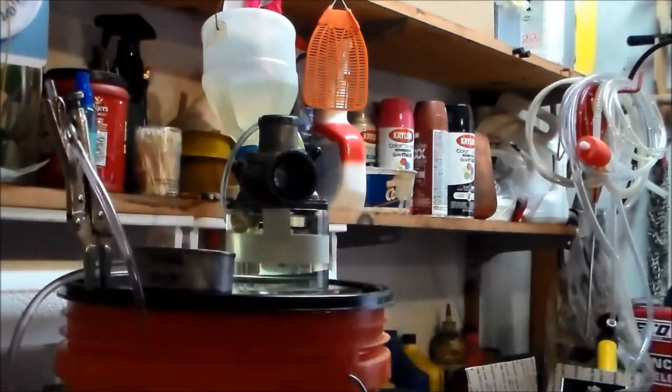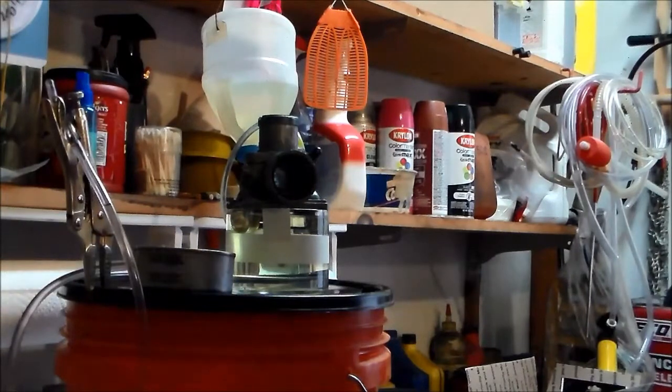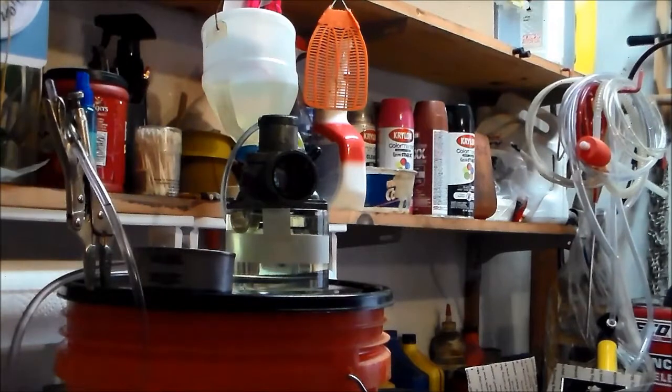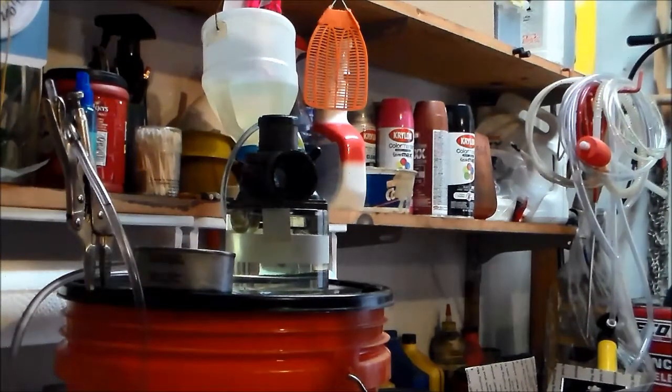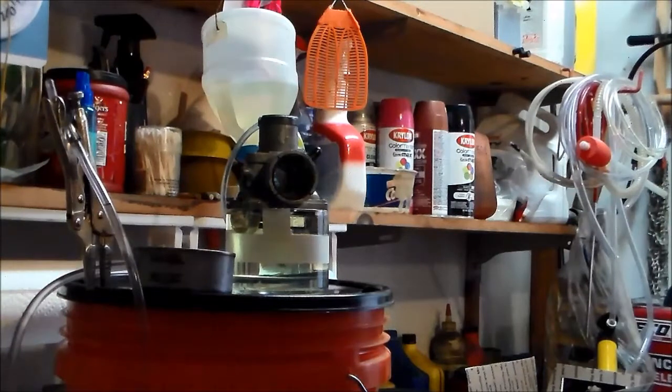Hang it back up. And the other nice thing about this is, if you have a needle seat leak that's bad, you'll see it, because it'll just keep going up and up and up. So anyway, that's kind of, I think, what the benefits are of doing it this way. You can actually see everything work. You can really see the level for real. You're not guessing. You can do a function check. There's just so many advantages, I think, to doing it this way. So anyway, thanks for watching.